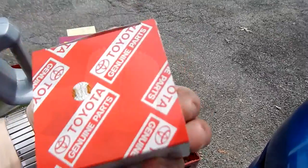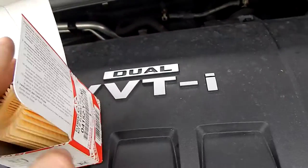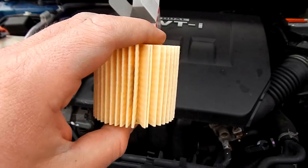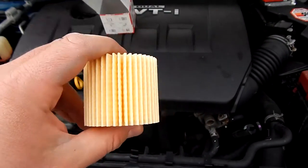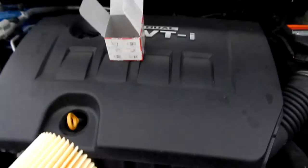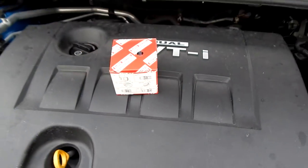There's something I have to say about the oil filter. This is what they look like, and there's only one place you want to get a cartridge filter like this from, and that is Toyota — and it was only five bucks a piece. The reason for this is these cartridge filters — and this doesn't apply just to Toyota, same for GMs that use cartridge filters, Hyundai, Volkswagen, Ford Powerstroke — you get it from the dealership. Very strict patents. Others in the aftermarket might have a different height on that filter, and that could affect the filtration as well as the quality of the filter medium. Five bucks a piece — it would be a little more absurd not to get it from Toyota. That's my whole recommendation any time you're running into a cartridge filter in any vehicle.